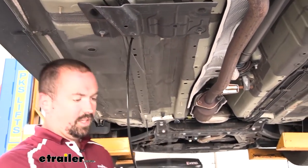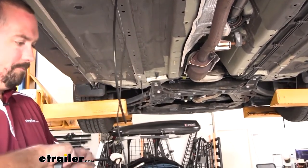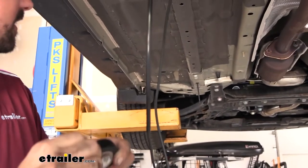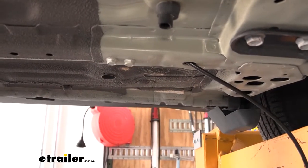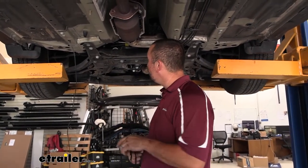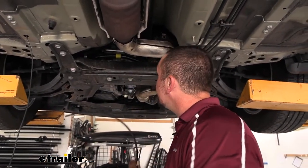What we'll do is take our wire end and just tape it to our pull wire — that's going to allow us to pull it through and it's going to be protected in the frame. We're going to use that same fish wire technique to get this up to our battery in the engine compartment. Again, make sure we're not hitting any suspension, the drive shaft, or any exhaust. We'll go ahead, get this passed up, pull it through, and our wire will be ready to connect to our positive terminal.